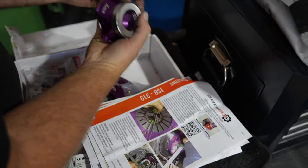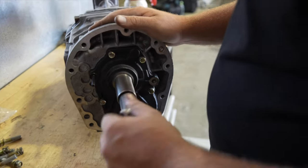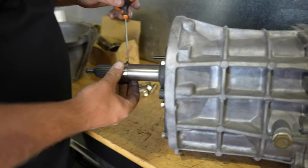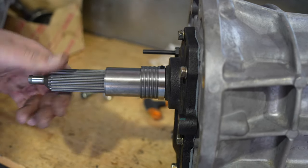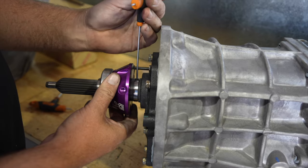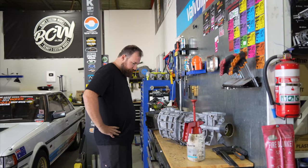So if I get the clutch, I can put the input shaft bearing locating pin on — that's what we want. This sucker. I don't really know why there's two of them. No touching. No grinding. So good. I might as well put the snout on. How do you figure out how far along that shaft you need it? Well, it bottoms out, but then on that thread you've got to set the height of the actual clutch. Then the concentric bearing — you adjust the height of that to suit the compressed height of the clutch, or the installed height of the clutch. Currently just putting it on for the sake of having it look right.